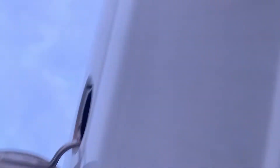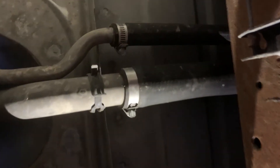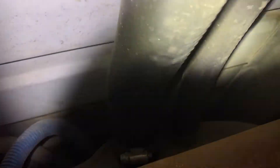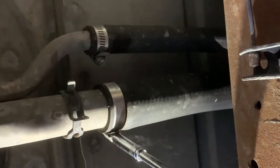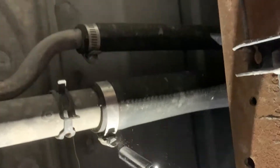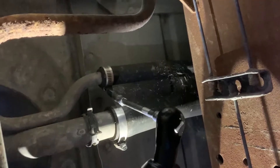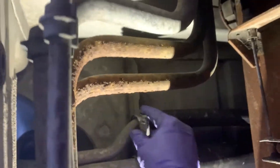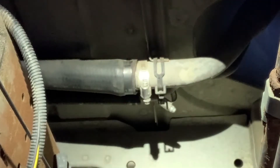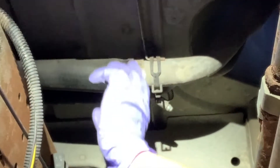So that's the fill port that goes to the outside and it goes down here to those hoses. You can see those all the way over there to the top of the tank. The big one is the main fill and the other one is just a vent, but I'm pretty sure we can just remove this side and then just bend them out of the way as we're dropping the tank. You can just move these — there shouldn't be any gas that comes out unless your tank is full.